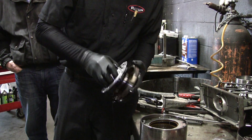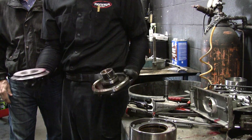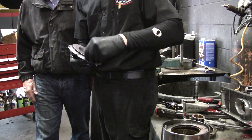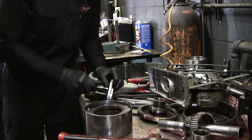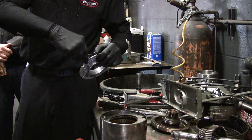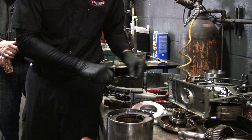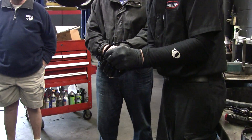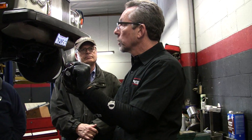And that's what we were hearing — that thumping. Is this thing applying? So the passages are in there. You've got these rubber seals and they're a lip seal. The original ones had little metal expanders. The modern ones are nice rubber seals. This is a lip seal — kind of like a regular one where this center section fits into the groove and you've got a lip at an angle and it holds the pressure.